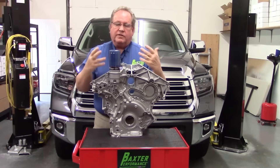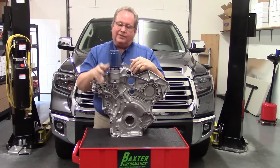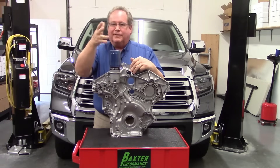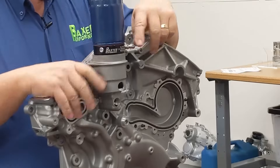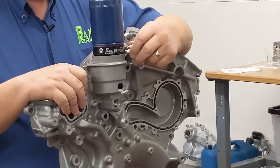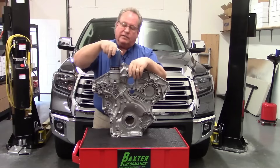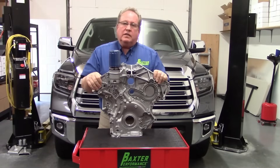Once this is all installed and your engine has been started, it's all filled with oil. For an oil change, you can't simply take the oil filter off because it would make a big mess. So we've included a Schrader valve so you can blow it down with compressed air for about three seconds before your oil change, which evacuates the oil filter completely so when you remove it, it doesn't spill a drop.